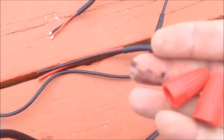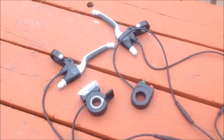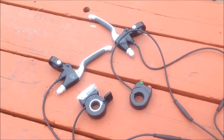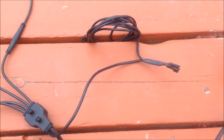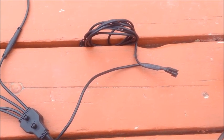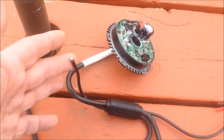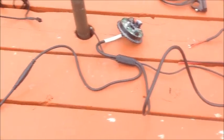The third wire runs up to the 10-pin wire harness plug, which connects to the brake levers, the throttle, the cruise control button, and the horn. Also coming off that wire is one that goes to the lights. That light wire was included originally on the Magic Pie Vectors but I've stopped including it since people aren't using it and are just cutting it off. If you want to hook up lights it's easy to do — there are instructions on the website. There was also a Pedelec plug on the controller but very few people use it so it's no longer included.